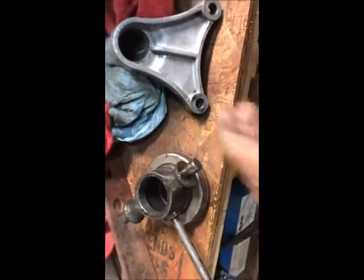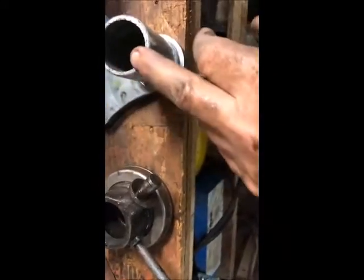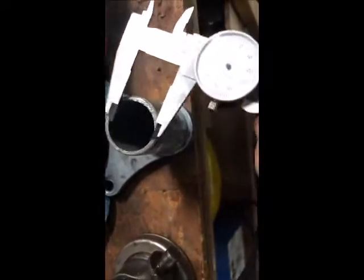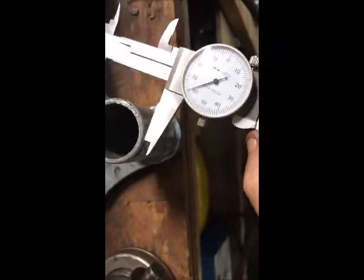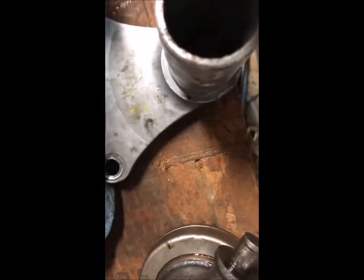That's the situation here. When I went to checking this new part and tried to put the throw-out bearing on the yoke on top of this sleeve carrier, I found out that the sleeve carrier was a little bit bigger than the actual piece that had to go on top of it. You can see where it'd be on this sleeve versus where it'd be on the other - it's still a little bit off, but it's getting closer.